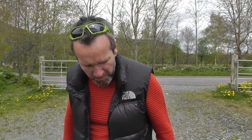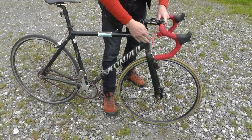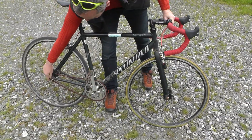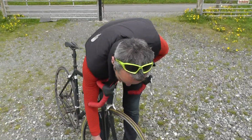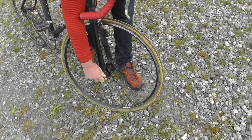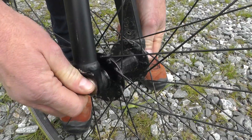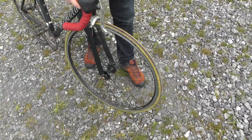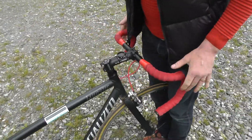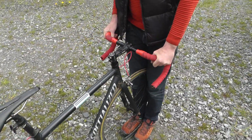What we're going to do just now is go through a bike check just to make sure your bike is safe before you go out on the road. We call this bike check an M check because it follows the shape of the letter M. Starting here, we go up to the handlebars, down to the pedals, back up to the saddle and then down to the back wheel. Check that the front wheel is attached. Most bikes nowadays have a quick release attachment or nuts and bolts — just make sure they're nice and secure and that the wheel doesn't wobble. Then come round to the front of the bike, hold the front wheel with your feet and knees, and check that the handlebars are nice and secure with a good push and pull.